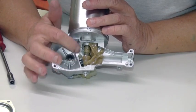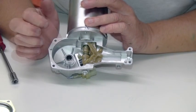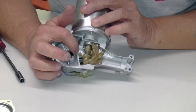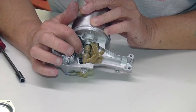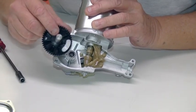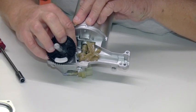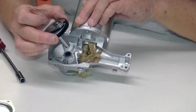Here is the spindle — the worm of the wiper motor. This turns, and here is the bearing that accepts the shaft of the drive gear. Down inside there you can just see a little white button. This is the switch that controls the park of the wiper motor. On the back of the wiper gear there's a little white nylon block which is raised, and as the wheel rotates it will press that little white button and disconnect the switch so that the wiper blades always park in the right position.